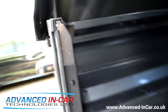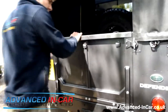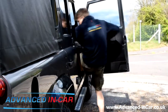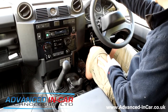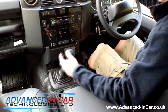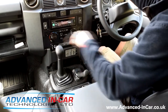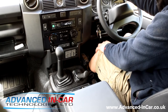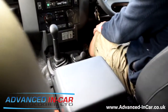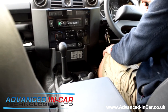I'll just jump into the vehicle and give you a quick test. We're now inside the vehicle — the engine's already running. I'm now going to put it into reverse gear. You're going to get your standard beep just to say it's awake, alive, and ready to go. If there's any more than a single tone, chances are you've got an error with one of the sensors. I'm now going to reverse slightly — we're on a slight gradient — and at 1.5 metres your audible buzz will start to work.